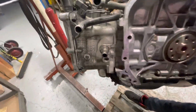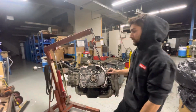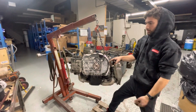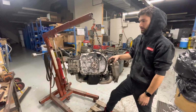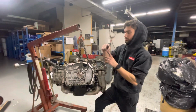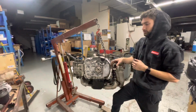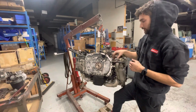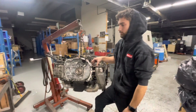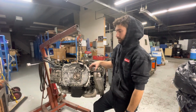So as you've probably seen and heard a lot about them, I honestly think that they're a great investment. And when you get one of these that come with it, all you need is some 5/8 tubing or heater core tubing. And then I get the aluminum tees from Advanced, they sell them, they're 5/8. And they're just a little 3-piece tee. And then just clamp it all together, you tap it into your return line on your heater core, and it'll reduce the temperature in that cylinder by about 20 to 30 degrees, is what the graph statistically shows by the young man that did all the research on it.